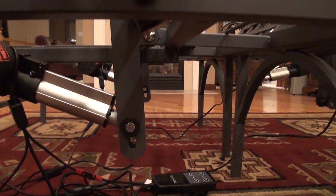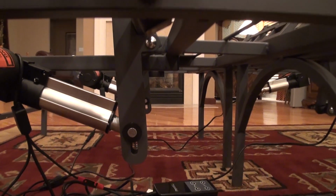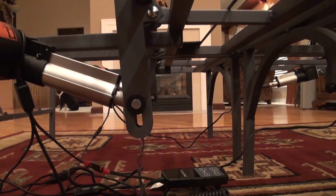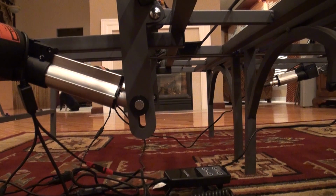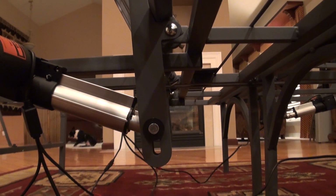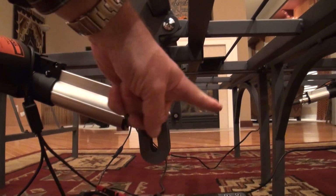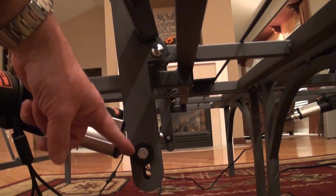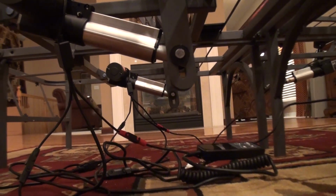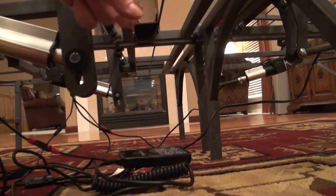All right, one more thing. So if you're mounting this in the van and this is going to be your garage space underneath the bed, what I was curious about is, now I'm in the front of the van right now, we'll be looking towards the back doors where we're going to orientate the bed. But we've got 6 3/4 inches total height loss. Now this piece here swings up here. So if you're going to have anything mounted below, you'll have to keep that in mind. So if it's bikes or boxes here, 6 3/4 to the bottom edge. And again, that swings up to the top.